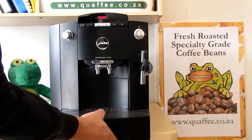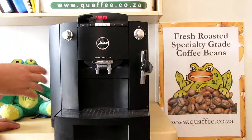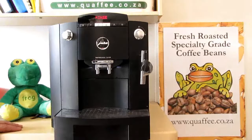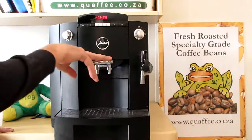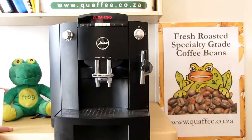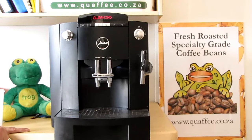At this point the machine will ask you to press rinse. You can either use another cup or something similar to catch the water, but because the tray is quite big I wouldn't worry about it. On the F50 you can use the grinds tray and put it underneath. I normally just drop this down and then press the rinse button. What it's doing is making sure the machine's temperature is correct for the rinsing process, actually running water through the machine. You can see the liquid is quite dirty, so the machine does need a clean.